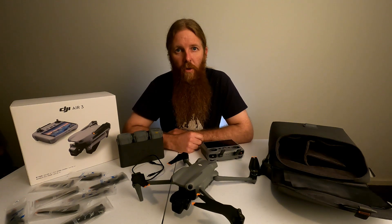In the manual, DJI do state that either a 65-watt or a 100-watt charger is what you want to be using — the 100-watt is really ideal because that's going to give you the fastest charge. You need to make sure you're getting a USB-C Power Delivery (USB PD) charger; if you're not using that, you're just going to take forever. I did try using a Samsung phone charger which is only about 15 watts — it just wasn't going to charge the battery, maybe ever.